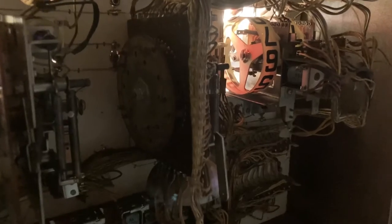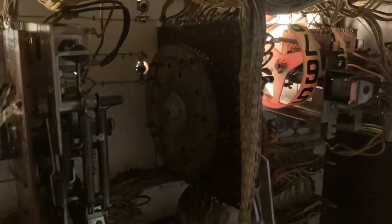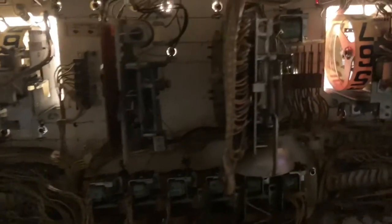I mentioned earlier, this game is a lot like playing a card game where you're trying to beat the dealer in 21. So what this does, not only the match, is determine the hand that the dealer has got. And it had some weird things with that. Again, once I scrubbed it, cleaned it down, and adjusted it so that it was orienting itself just right, it started working correctly. But that's a lot of what I ended up having to focus on here in the back. There were a few other switches that got a little bit of adjustment, but for the most part, everything else was fine.